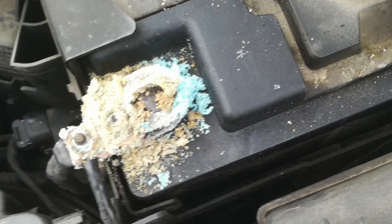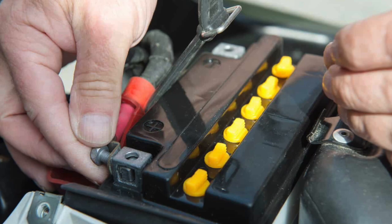Number one: make sure you have a clean battery for your personal watercraft. We're concerned with moisture and corrosion because the inside of your engine compartment is super humid and gets super heated. That moisture starts to settle out of the air onto your terminals, which can quickly corrode them. A bad battery connection is not only a quick way to lose a charge, it's also a way to develop high resistance.